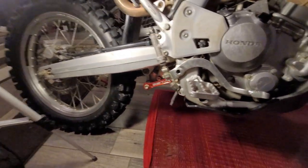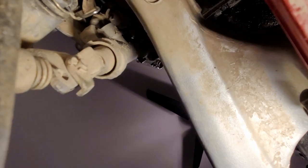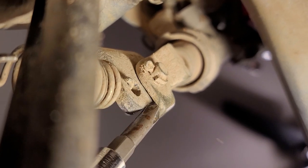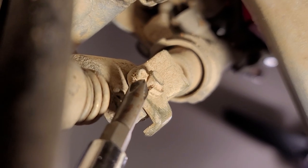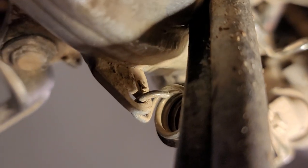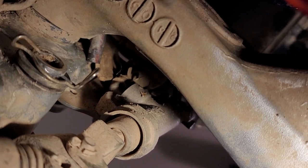We're going to have to slide underneath the bike, so bear with me for just a second. I'm going to shine my light as well — hopefully it doesn't blind the camera. Now we're underneath the bike. As you can see right here, there's another little cotter pin. That's the cotter pin I'm not going to take out. It's kind of like a slide pin — you fold these two tabs over, the cotter pin slides right out, and that thing will slide forward. And then there's also this one here, which I'm going to pop out for you. It just slides over the bolt and goes through both sides.